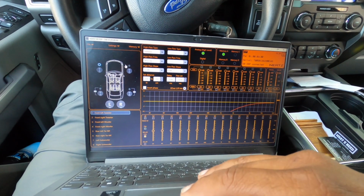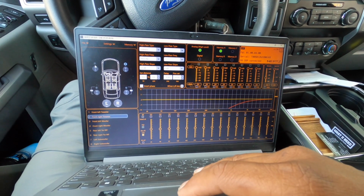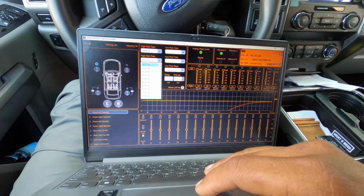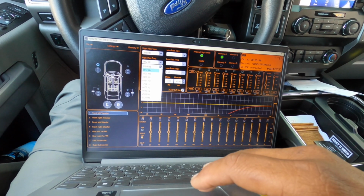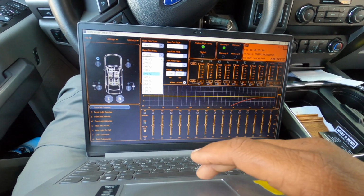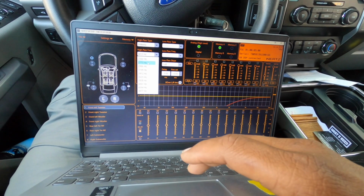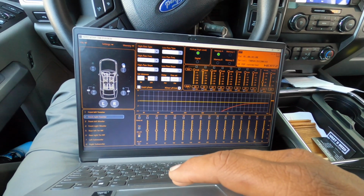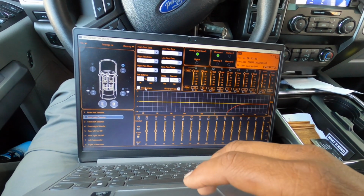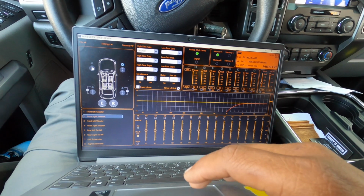So we're at Linkwitz-Riley on the tweeters. That did both. Now we can change that tweeter. These are really big tweeters, so let's say 2773 on both. We want to make sure it's 24 dB per octave. That's what I like, and we can always change the crossovers.